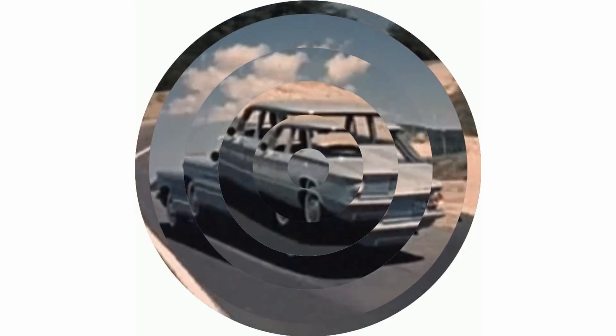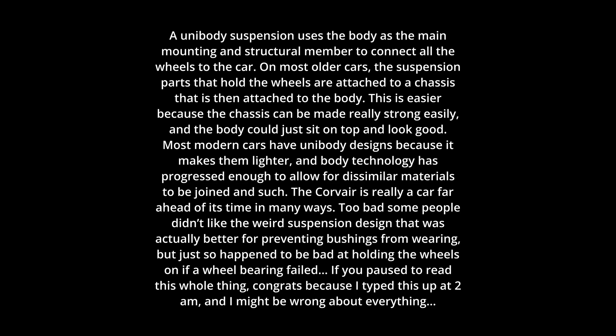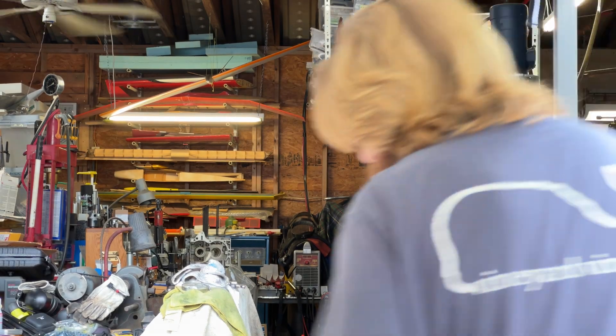You should be wondering how can I fix my suspension, especially when the suspension is a unibody? Well, there isn't really a kit that can fix both the front and rear suspension — you just have to modify your suspension to replace all the offending bushings one by one. But one part you can't modify is the lower rear strut rods, and that's where we come in.